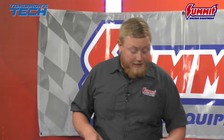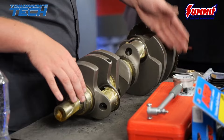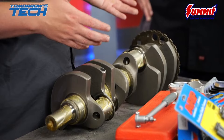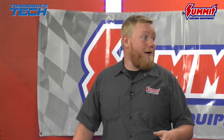Dynamic balancing is where you weigh your piston and rod together as a combination, then match that to the counterweight — or bob weight — on the crankshaft. They can either grind the crank or add metal to it. Adding Mallory metal to a crank is one way to do this — it's a really expensive, dense metal. You want to make sure the assembly is harmonically balanced, because if this stuff is all off, you'll have vibration issues. The closer you can get it, the happier the engine is going to be.